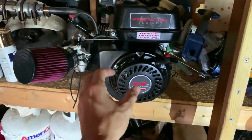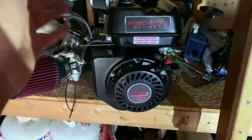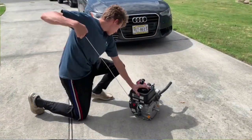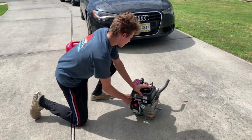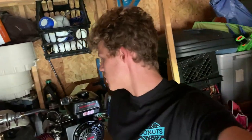This video will go through how to build the engine, what tools you need, some tips and advice, and especially how to troubleshoot - because sometimes they just don't work when you first start it. When I first started the engine, it was not working. Turns out the issue was my valves weren't closing all the way, so they weren't building up pressure.